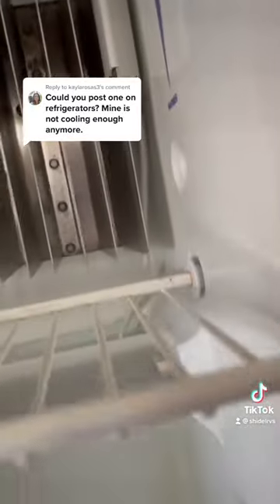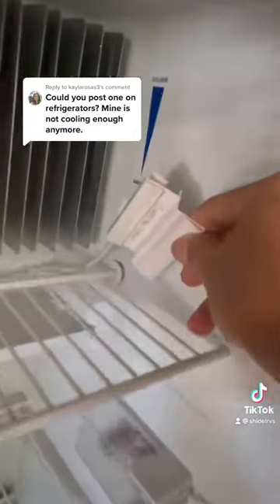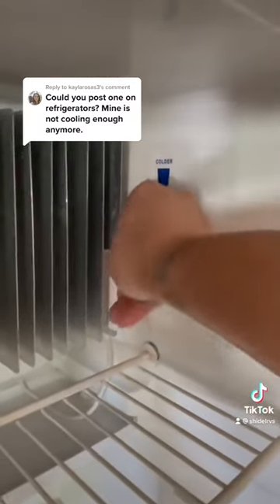It's this long white cord hanging out of the back. One of the most common problems is because it becomes unattached to this clip — it can come off during travel. Just snap it back into place and your temperature can be controlled by moving it up and down.